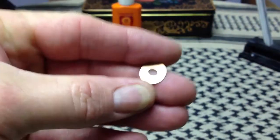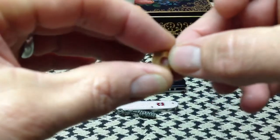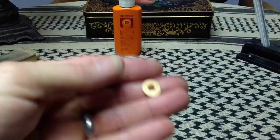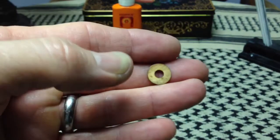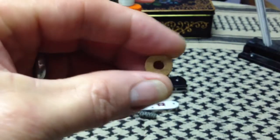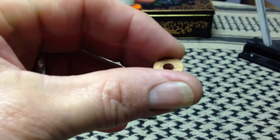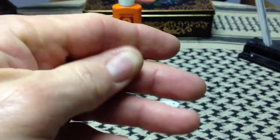There used to be a lot of mechanical devices in the world that used similar bearings — and yes, these washers are indeed bearings. The one that leaps immediately into mind is the internal combustion engine. They're shaped a little differently, but where your connecting rods connect to your crankshaft, there are flat but curved half-circle or half-circumference bearings — two of them each time the connecting rod connects to the crankshaft — that stay in one place, fastened securely to the inside of the race in the connecting rod, and the crankshaft goes through the middle and spins on that bearing.